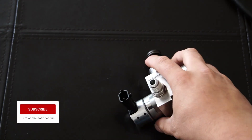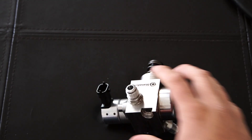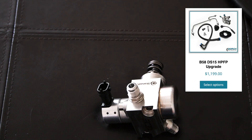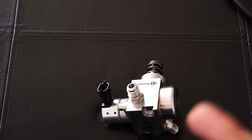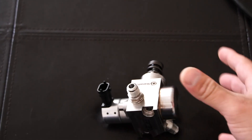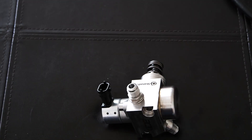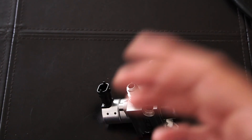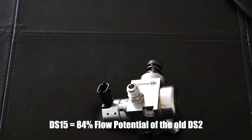Let's talk about the DS1, or as it's now known the DS15, which is basically a 1.5 version revision. The DS15 is an upgraded version of the DS1 and you can find a 19% increase in flow. With the rail pressure still around 200 bar you'll see an increase in flow, and as you go up in the rev range closer to 7k that percentage increase decreases but it's still a good 10%. I'll show some graphics on screen — on the DS15 you can see where at the beginning it's around 19% and as the rev range goes up that flow drops down to about 11%.